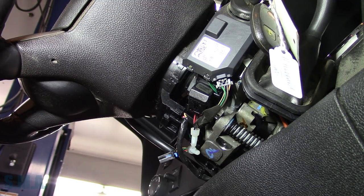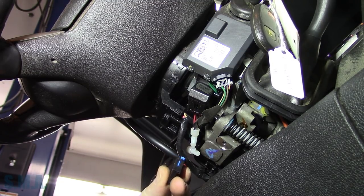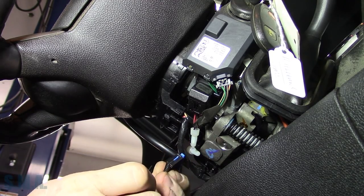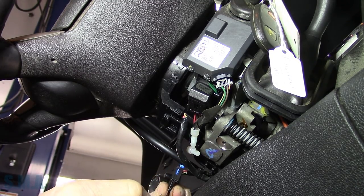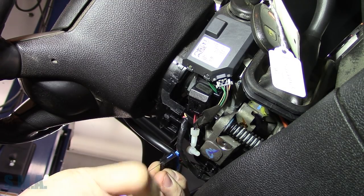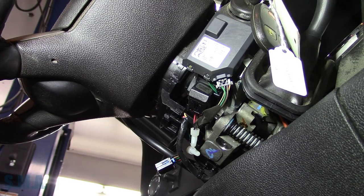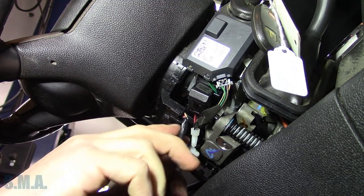According to the diagram, A and B - so B should be the tan and A should be the ground. I've got us a couple probers here. We're going to very gingerly front probe, just touch it, and then touch these two together and see if it scares us. There - that answers the question. Nothing to do with Best Buy, even though we sat here trash talking them about their crimp-on wire nuts. That tells us 100% definitively that the clock spring is bad.